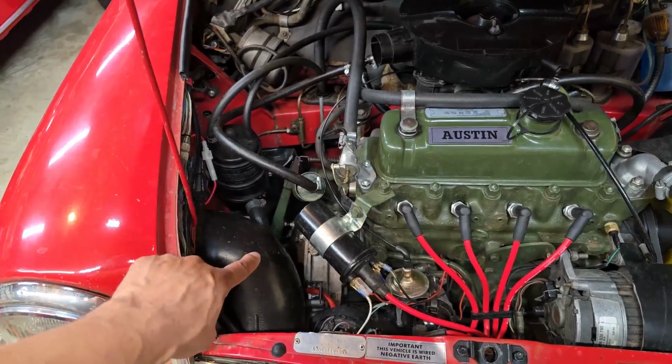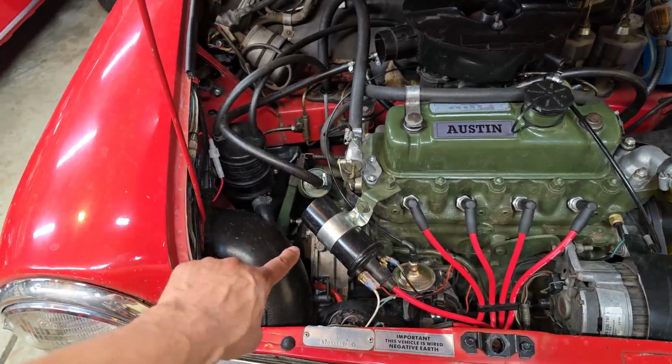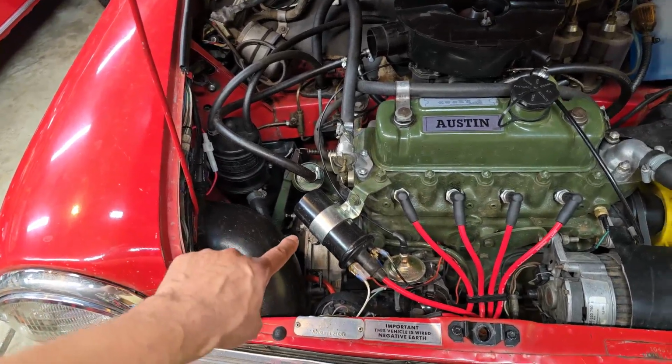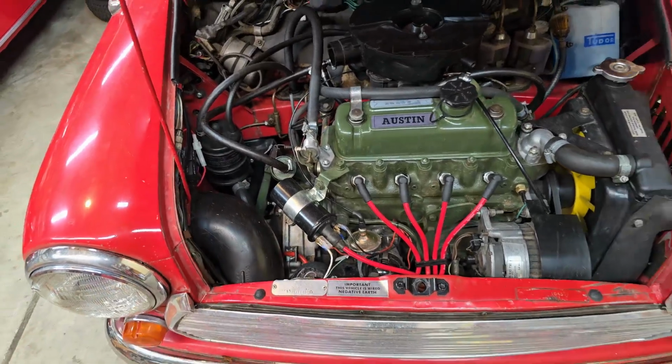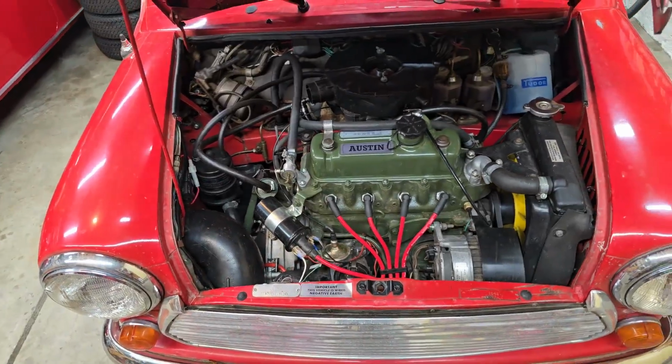So it's something internal. Either maybe the pin is broken off the arm, or perhaps it's a clutch problem, or again, like I mentioned earlier, a primary gear problem. But let me start taking stuff apart and find out what happened.